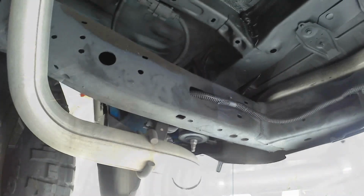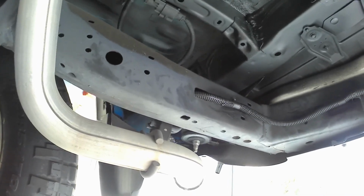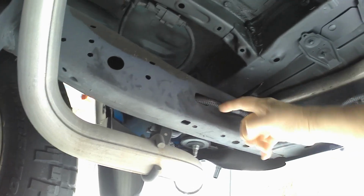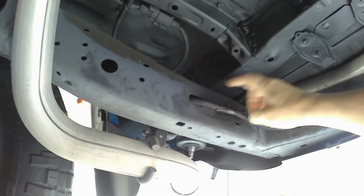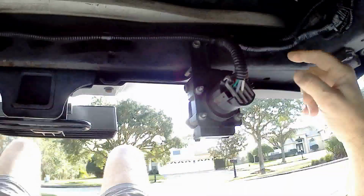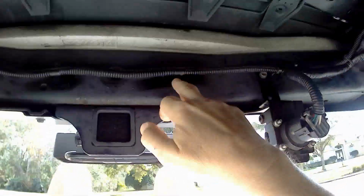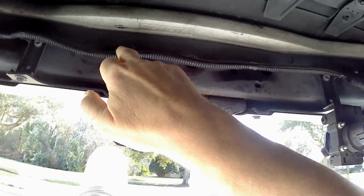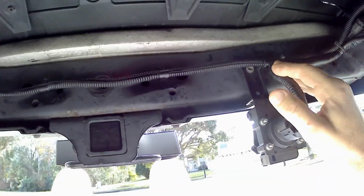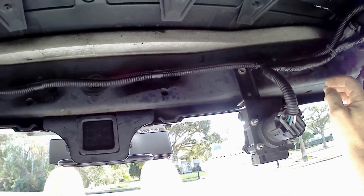So I saw in another video talked about the trailer hitch wiring. So I ran some wire and then go ahead and wrap this wiring loom around it. And I had a bunch of tie wraps in here that, well, it looked crappy and it looked amateur. So I went ahead and replaced it. I had some stainless steel cable clamps. And then, of course, I always give everything a little coat of like a rubberized undercoating when I'm done. And that kind of patched this up.